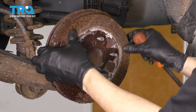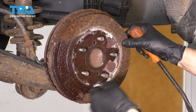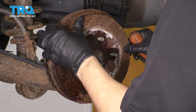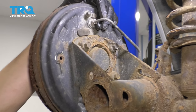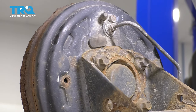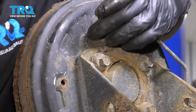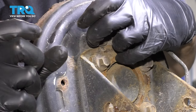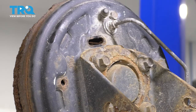Gently pry it from the backside. At this point, all that's holding us up is the brake shoes, so just be gentle and walk it back and forth. In order to release the drum, you'll see that on the backside there's a little rubber boot here that if we take off, we will have access to the adjuster. If we turn it to contract the shoes and squeeze them together, then we'll be able to easily remove this drum.